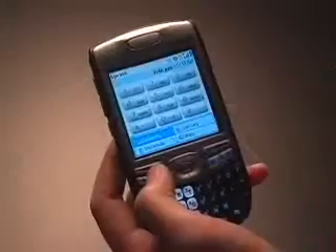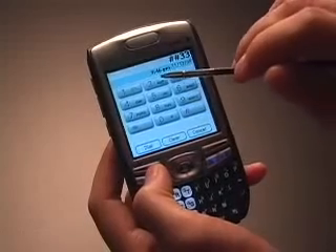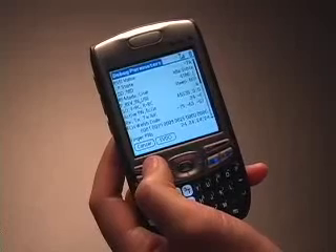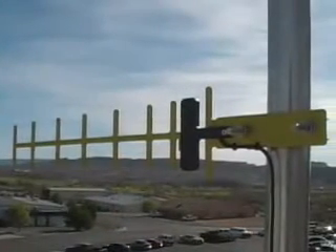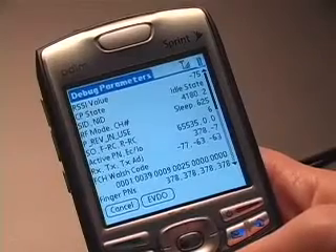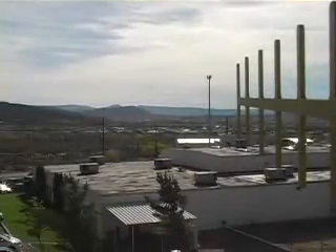Once your cellular phone is connected to the Yagi antenna, put your phone into test mode. The process for putting your cellular phone into test mode varies. Visit our website for detailed instructions on how to put your particular phone into test mode. Now that your phone is in test mode, you can adjust your Yagi antenna for maximum performance. Turn your Yagi antenna in 10 degree increments while checking your cell phone's signal level. At each point, you may need to wait a few seconds as the phone updates.